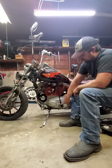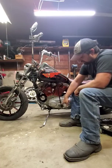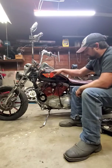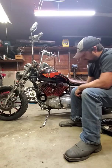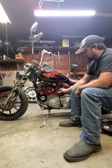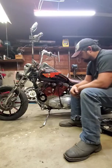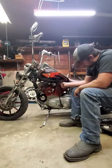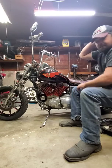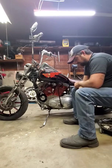It's hollow, and it fit right over that inner shifter lever, about perfect. The inner shifter lever obviously has a threaded hole in it, so when I shoved that tube over it, I just threaded that bolt right in there. Boom, perfect. I painted that orange and painted everything kind of black there, and sat on it and felt where it felt comfortable. I had to manipulate the tube a little bit so it didn't slap against the tank going down the road, because I know a lot of the kits have a bracket system that runs out to help keep it secure. Like I said, I didn't want to spend the money for that, so this is just stuff I had laying around. It worked out perfectly.